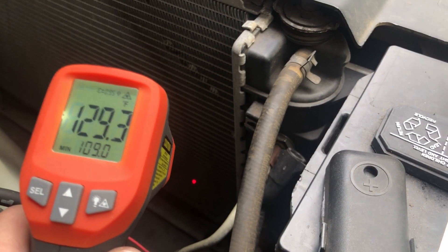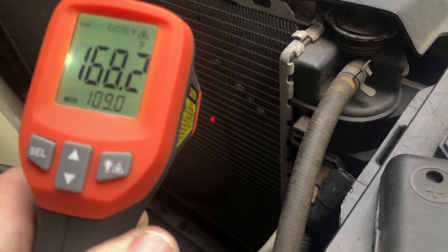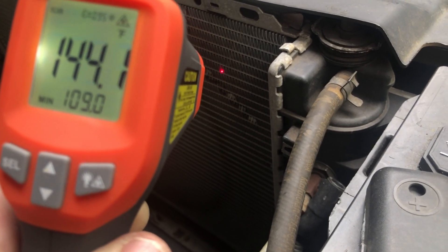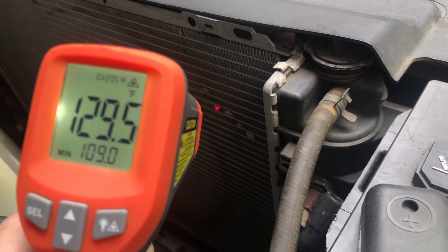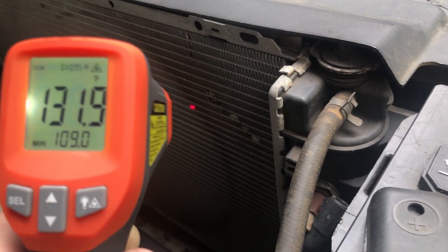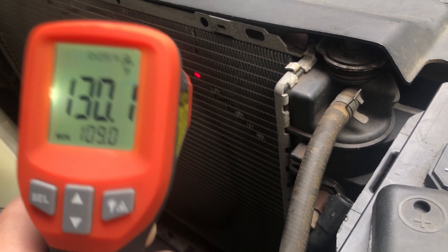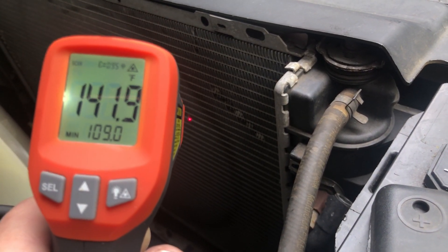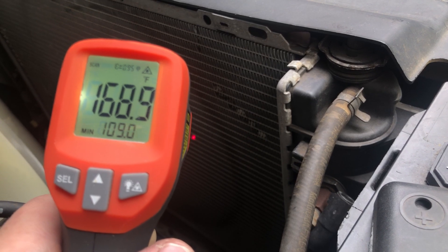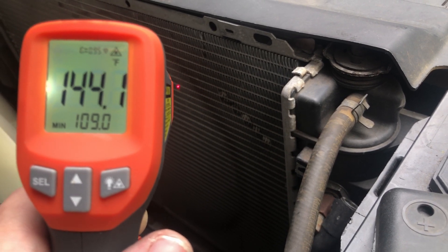It's definitely inconsistent. I don't know if that's normal — I may be hitting the tubes and then an air section in the tubes. But still, this whole area right here is very suspect. I shouldn't be seeing 130 degrees here. Going down it gets hot again, but over here it's like a little dead spot right there in the radiator.